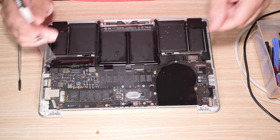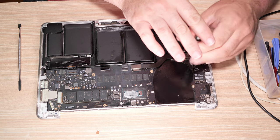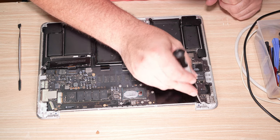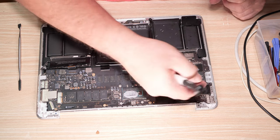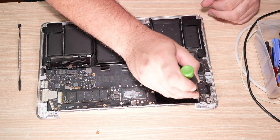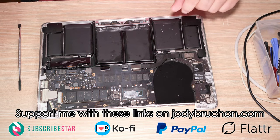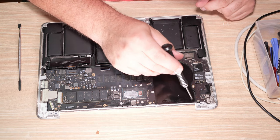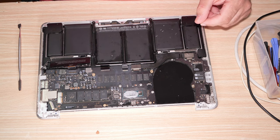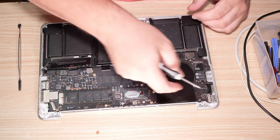Yep, there we go. Now, what about the daughter board? There's clearly one right here beside this connector. Okay. All of the motherboard, daughterboard screws look like they're the same size, except this over here looks like it's holding it and is probably much larger. And that is hinge sized, which was, I believe, a T8. Can't remember, but it's big. Yep, it definitely was holding it in. It's quite big, it's unique. It has a cylinder underneath the head, so we will pop that. Let's see. Anything else? Looks like nope.